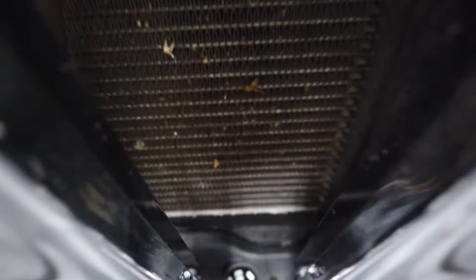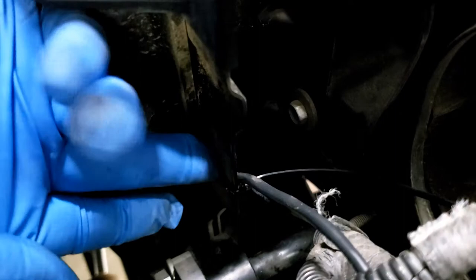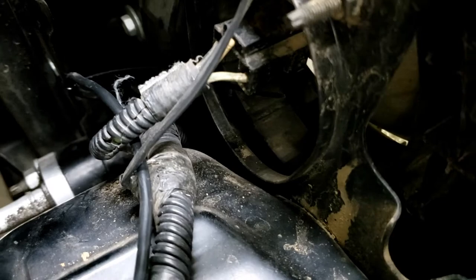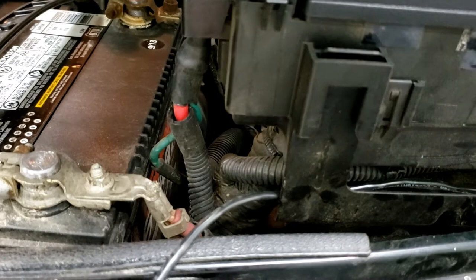Let's take a peek in here. There's the blue one on the right — see that LED pod sitting in there. I got the wires all tucked in, nice and neat. We have three of those lights: white in the middle and red on the left. Now we're under the hood at the radiator support — there's this large hole where I zip tied the wire after it came up from the opening below. I ran it right along here with the headlight and fog light wiring, along the fender well by the air cleaner, zip tied to that wire loom, ran it under the fuse block, and over by the battery. That's it for the grill lights — now we're going to move on to the rock lights.